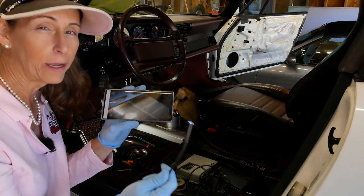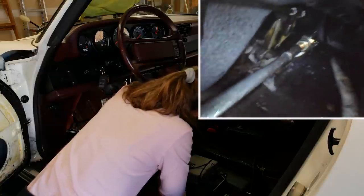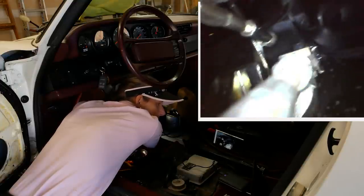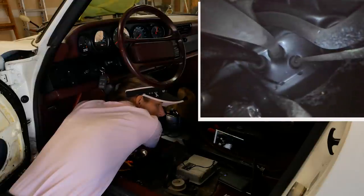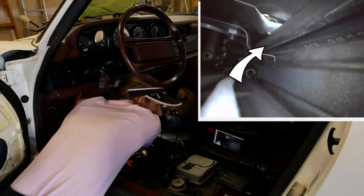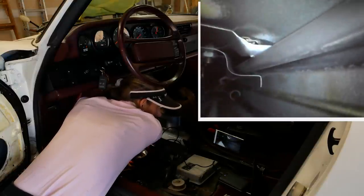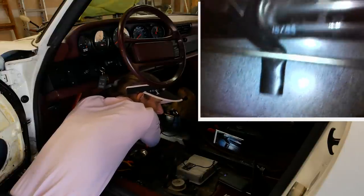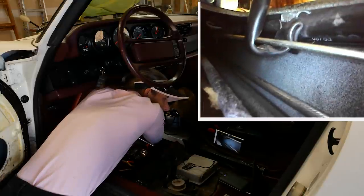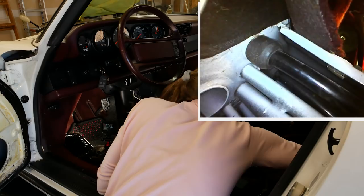Going forward in the tunnel, there are the fuel lines as they exit up front, and you can see those rubber grommets. It's a busy little tunnel in here - there's our fuel lines up there, and also a metal rod. You can see if I push the rod down a little bit there's a clamp right there holding the fuel lines up to the top and keeping that metal rod away from them - we'll have to pull that out of the way as well. There's a better image of the clamp, and there are our fuel lines as they exit the tunnel on the engine side.